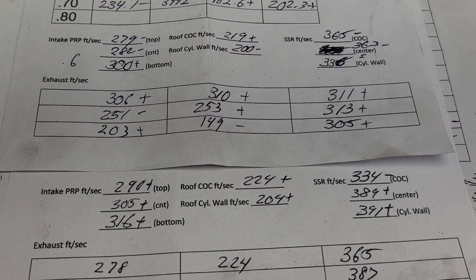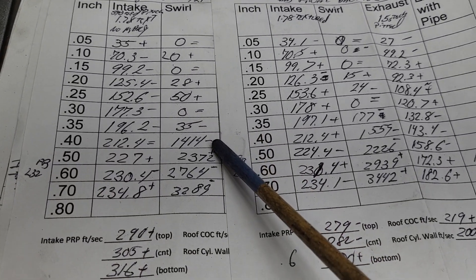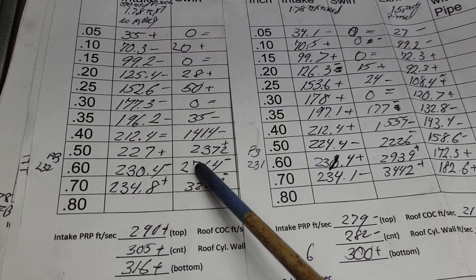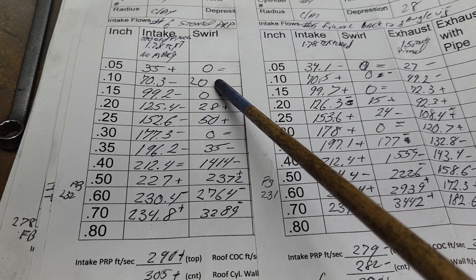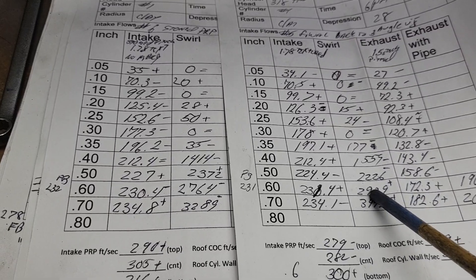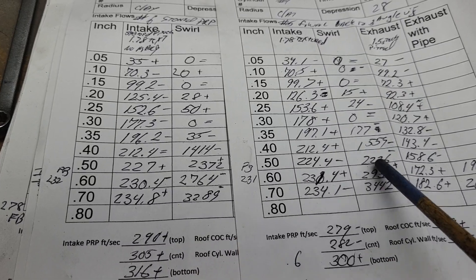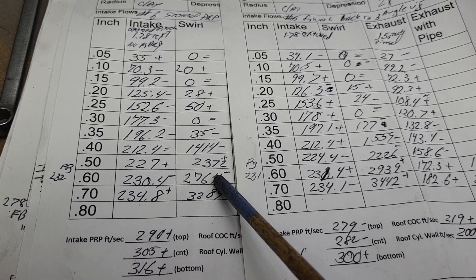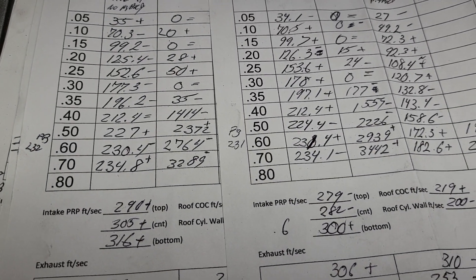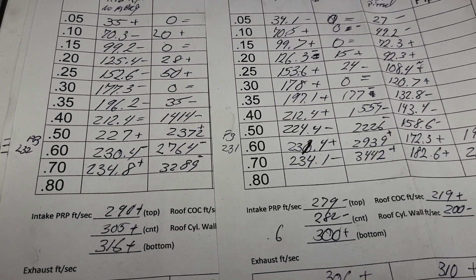Let's take a quick look at the swirls. Fifth is on the right, sixth is on the left. Overall they're both fine — both good at 600. I'd really rather have it a little more steady instead of zeros and then going up and down — I'd rather have zero, zero, zero, zero and then start to go up. Our swirl is changing because we have more air going straight now, that's why we got a plus here. When we go to take a look at our sixth cut with sand-rolled pushrod pinch, things change a lot, and that's really interesting to me.